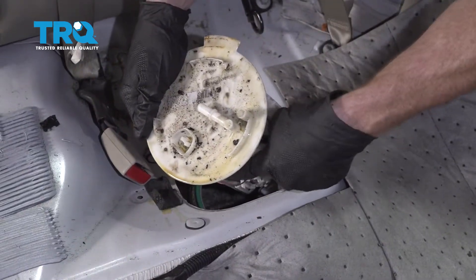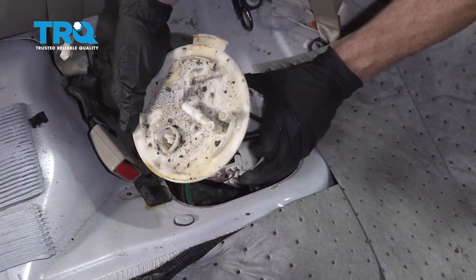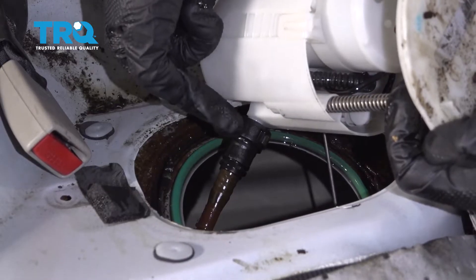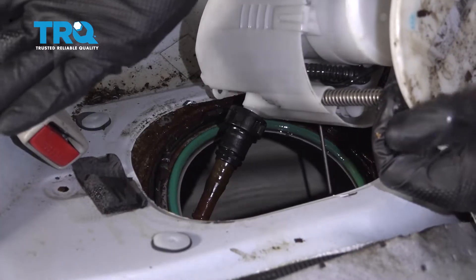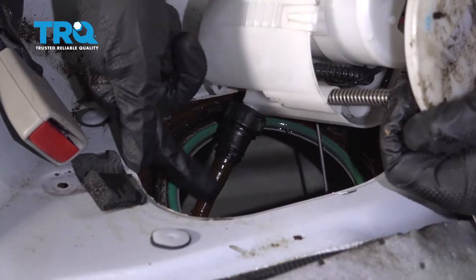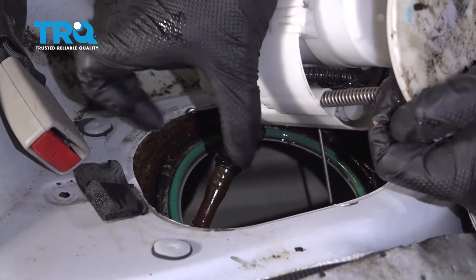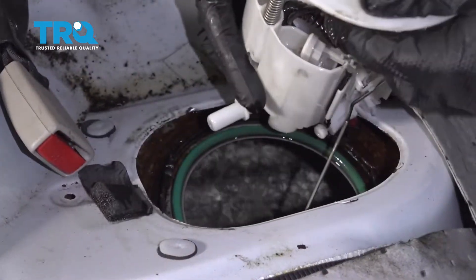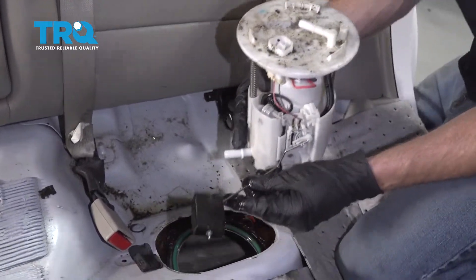Now the fuel tank is open and there is the possibility of fuel vapors in the area, so keep that in mind. Carefully grab onto the fuel pump and take it right out of the fuel tank. As you start to remove it, you can see there's still fuel inside the pump — make sure you don't dump this inside your passenger compartment. Now as we're removing this, you're gonna notice there's another fuel line that comes across here. That fuel line is a siphoning line that goes over to the other side of the fuel tank because this is the all-wheel drive version. To remove this line, find the two tabs — one here and one on the other side — squeeze on those and then remove your line. Now you can safely remove your fuel pump from the passenger compartment.